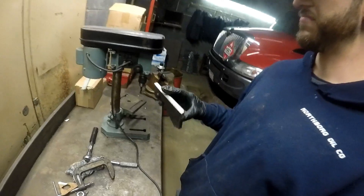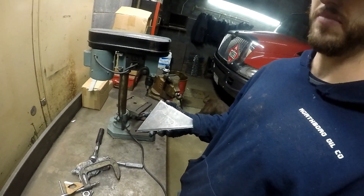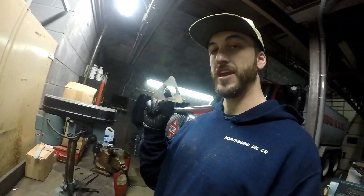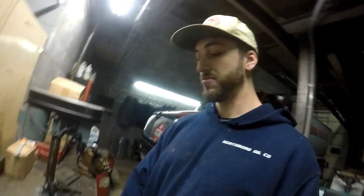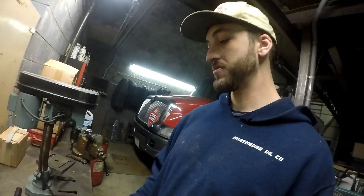What I have here is a piece of half inch steel that I've traced out the correct pattern for the flange on. The way I got the pattern is I took a piece of cardboard and hammered it on the flange — it leaves lines, and I traced them, cut them, transferred it on here, took a hole punch, punched the three corners, and I'm going to try and drill it out.